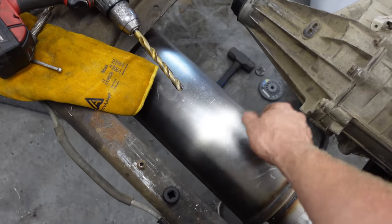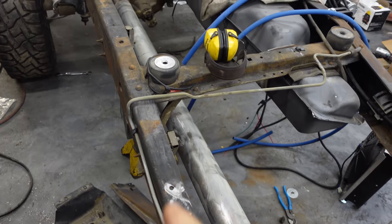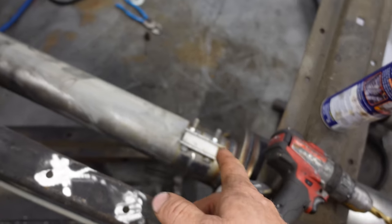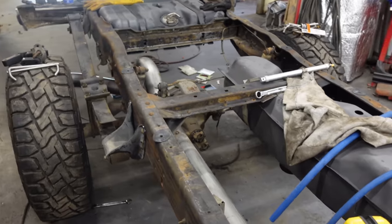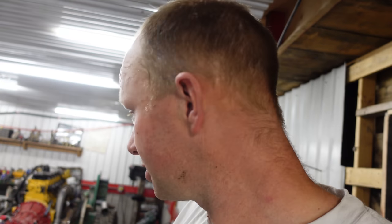So that's a much better setup than that tinny little flange that cat gives you, and they're not cheap. Now this isn't a muffler, it's like a resonator, but it's well packed, she's pretty heavy. The Silverado has 5-inch coming out of the muffler or resonator, but I went with 4-inch on this one, only because we're gonna be driving this thing for 10, 12 hours at a time. The drone sounds cool for about an hour, and then after a while it just gets to you, especially if we're gonna be sleeping in the back seat. But don't worry, Silverado still has 5-inch exhaust. That'll be the toy. And the C10 has dual 4-inch exhaust.